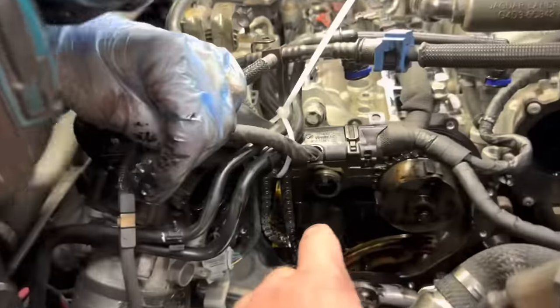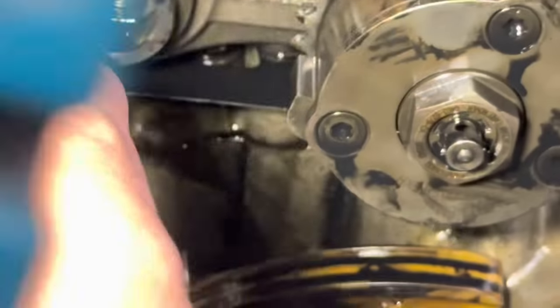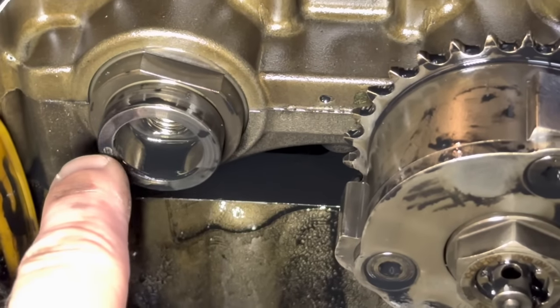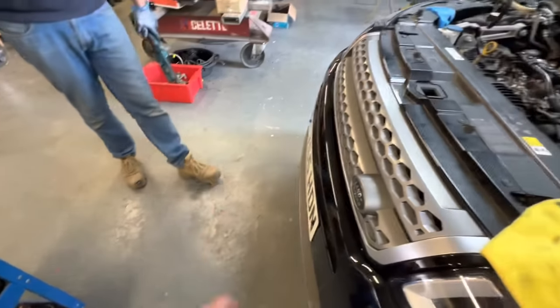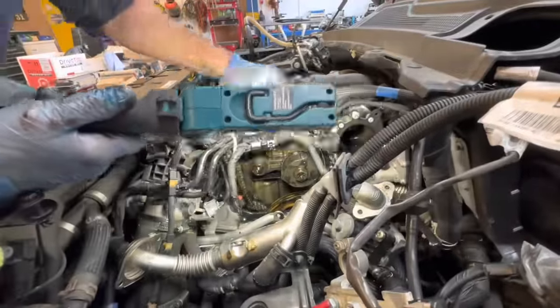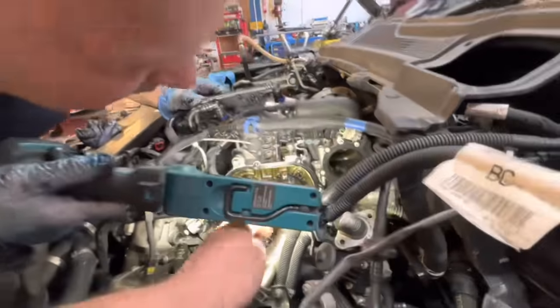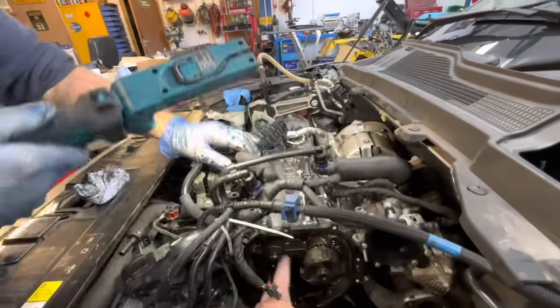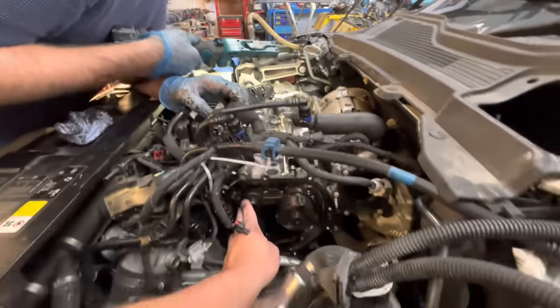Yeah. There's like a little alignment dowel. Can you shine your torch in there, bud, please? Little pin there. It's actually snapped, look. And when Chris actually lifted up the cog, the sprocket, the other half of the pin fell out on the floor. So we're going to move on and try and get that cam carrier off now, I think. Yeah. Tell you what though, Chris, is it moving that end? It is. Yes. Yeah. Well, that's more like it.